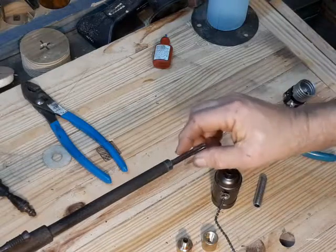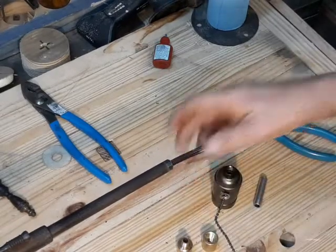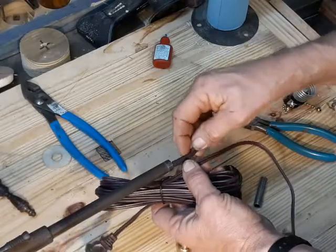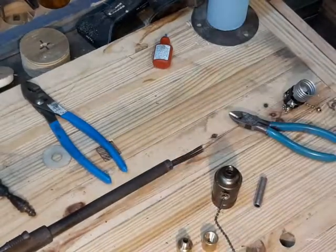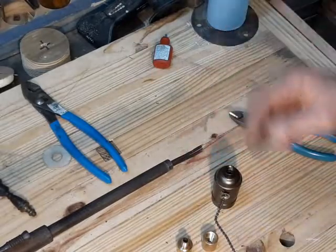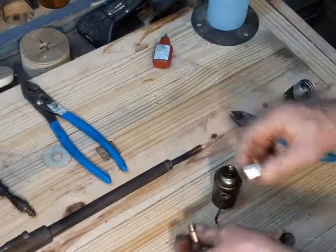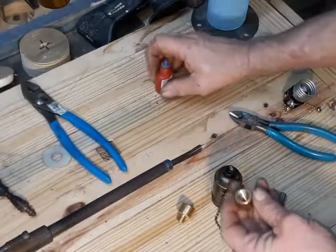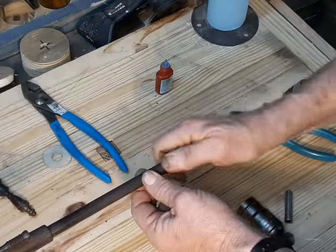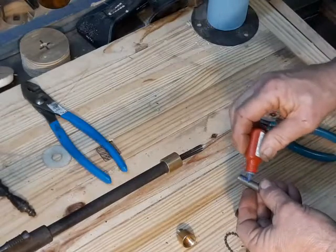The cord I'm using is what's called SPT-2. What that means is that even though the wires on the inside are the same size as SPT-1, the insulation itself is a little thicker and more resistant to abrasion, so you'll commonly see these used on floor lamps. When it comes to running SPT-2 through eighth-inch pipe threads, sometimes that's a little tight, so I'm going to be using this bushing here because that hole is just a little bit larger. A little bit of blue thread sealer will keep it nice and tight. I can run it down and give it a good squeeze with my fingers — that will be plenty tight once the blue stuff sets up, and I don't have to worry about anybody unscrewing it while changing the light bulb.